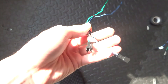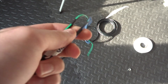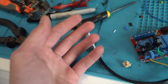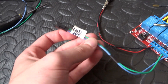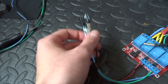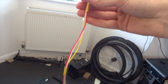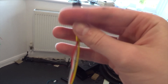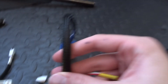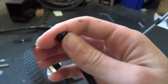Progress is being made - I've got the headlights all wired up and I've made the leads for the indicators, put the connectors on the end and labeled them, so this one's back right indicator. These are the shorter front ones. I've also added this connector which connects to each of the light outputs and feeds into the dashboard for indicator and headlight feedback. The wires that go to the Arduino to fire the relays are here, along with the 5-volt power for the whole module. Each wire gets a connector on the end, heat shrink to bunch the wires together, braiding on the outside, and a label - then the braid ends are sealed with a flame so they don't splay apart.